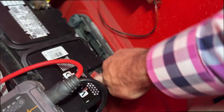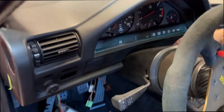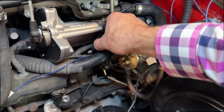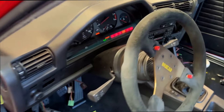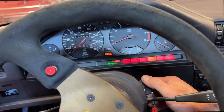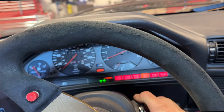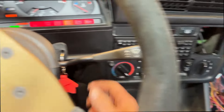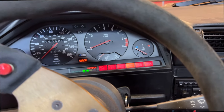I'm wiring this up into a larger power so it actually gets the power it needs, and the DME, when it does its switching, will actually open the injectors. Right now if I open up the throttle body and see inside, those are still bone dry — the injectors aren't even opening. I confirmed that the coils aren't even turning on when being commanded, so I think there's some sort of power starvation issue. The fuel pump is kicking on, so I know the fuel pump is working and it's getting fuel. It's just that the injectors are not turning on. We'll keep working it.